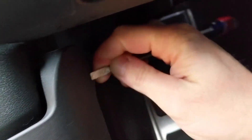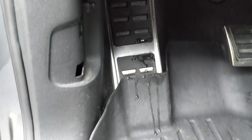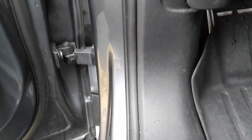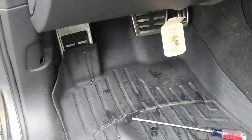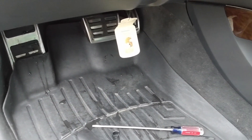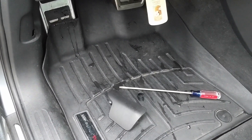Go right in here and pry that out — that is the clip that holds this thing in place. Pull up on this entire plastic trim. There's one screw right here you have to remove, but once you remove that screw this whole piece will come right out. That's where you get easier access to your CAN high and CAN low. You can find them because you're going to see a orange and green and orange and brown wire that are twisted together on the harness. The gray wire is CAN high and that gets connected to the orange and green on the car. The gray and black wire on the harness gets connected to the orange and brown wire on the car.